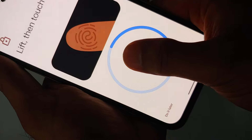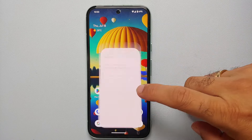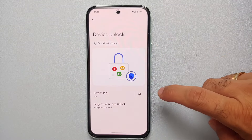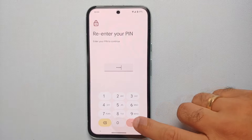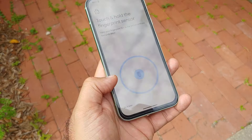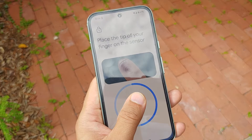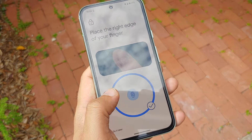The next trick to fix and improve the fingerprint scanner on the Google Pixel 8 series is to scan the same finger multiple times in different scenarios or different lighting situations. Go into Settings, then Security and Privacy, then Device Unlock, then Fingerprint and Face Unlock, enter your current PIN, and tap Add Fingerprint. Add the same fingerprint in about three different situations — indoor lighting, a dark room, and outside in bright sunlight — and hopefully that helps improve the performance.